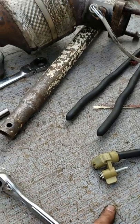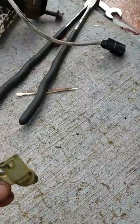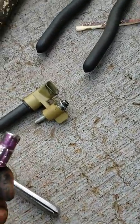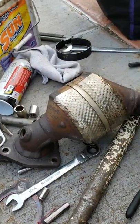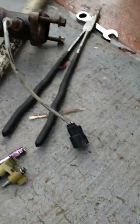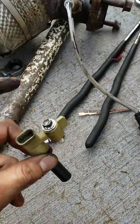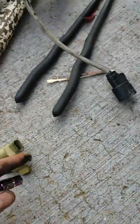The tricky thing is that Ford switched around the size of the bolts — they don't want you to figure it out. Everything was 8 millimeter, 8 millimeter, and then out of nowhere it's a 9/32" for this one here, so be ready for that. I made a video because there was no information out there on how to get this thing out. You might be able to squeeze it out without removing the catalytic converter, but I just removed it because it's so much easier. It's on an angle and you gotta hold and feel for the head of the nut at the same time.